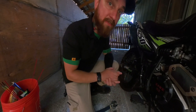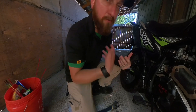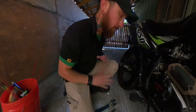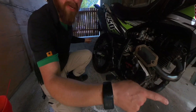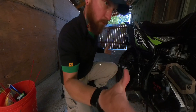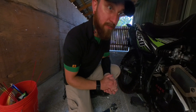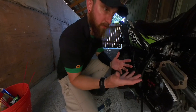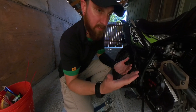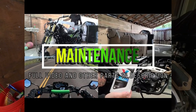Some other things at a thousand miles: the air filter — I'm going to change that out, probably not on video. Another thing is to check your tire pressures: it's going to be 40 PSI in the rear and 32 in the front for this one specifically. Yours may differ depending on your model. Another thing I won't do on video is change the oil. I use 10W-40 Valvoline. If you're interested in more about that, I do have a maintenance video and a full-length video from unboxing, building, maintenance, and getting it street legal.